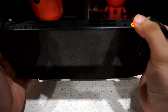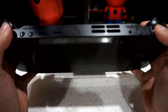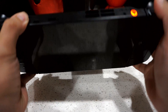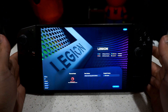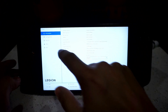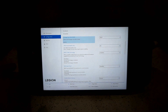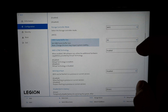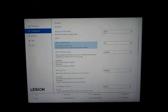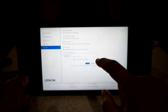The Legion Go has just turned off. All we're going to do is press the volume up button and the power button just once — just tap it, then hold down the volume up button. It's going to take us to a white screen and we want to go to the BIOS setup. It's only a touchscreen interface. Click on more settings, then go to configuration, then go to UMA buffer size. From our last video we had it at 4GB — now we're going to click on 6. 6GB is the best sweet spot for the Lenovo Legion Go when it comes to performance and gaming. Then exit with saving changes and click yes.